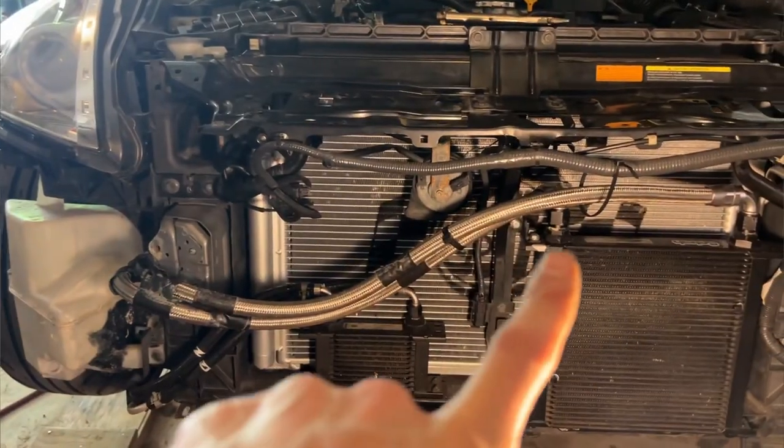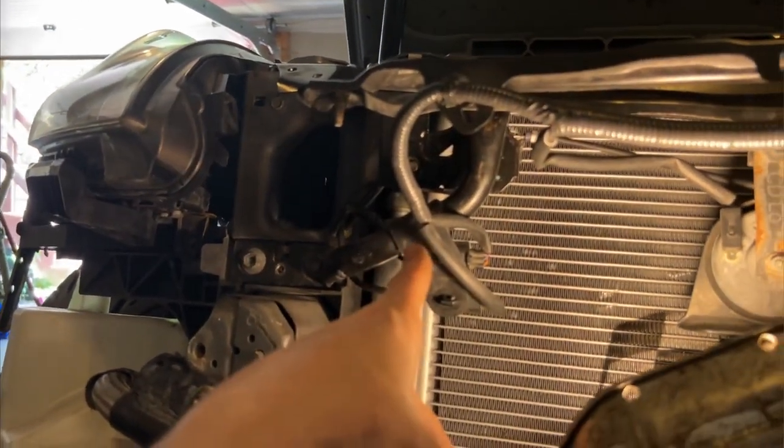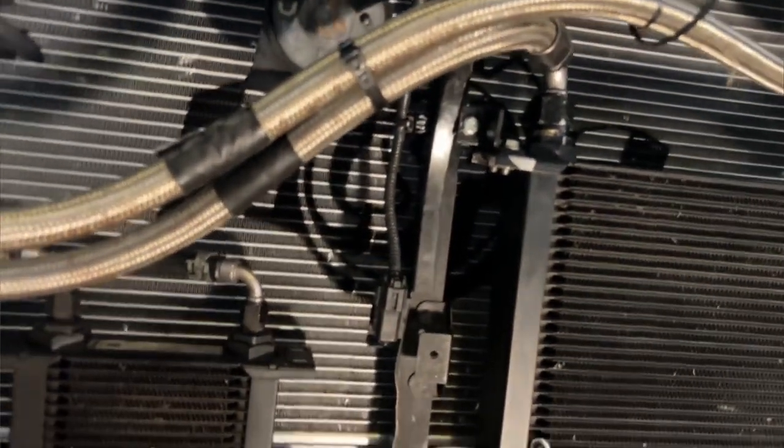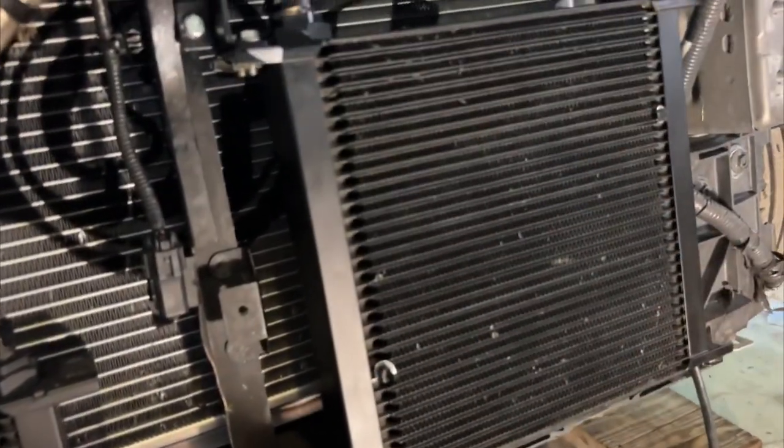This is mounted for all intents and purposes. Still gotta get this oil cooler line more cleanly routed - I'll tie the line to this port and probably also to this here, because we did have to move this oil cooler out basically two inches to fit this fan back there. It's a pull-type fan - it's gotta pull air through here.